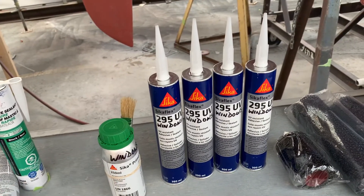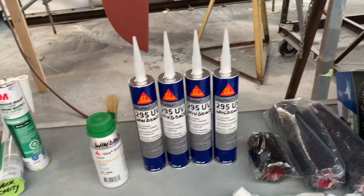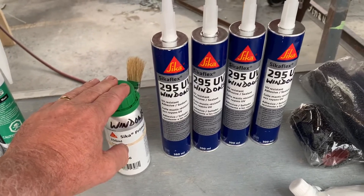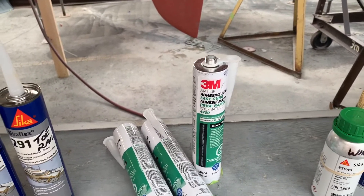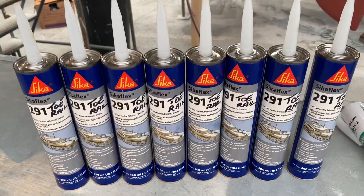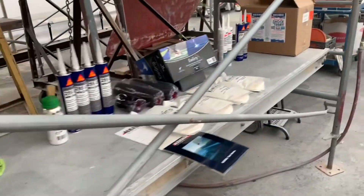We'll do a one-bag test first instead of putting it all in the gallon and mixing everything together. For the windows, we had to switch to a Canadian product because I couldn't get the primer for the U.S. product up here in Canada. So we're going to use Sikaflex 295 UV white for the windows, but first the primer has to be applied to the plastic frame so it gives better adhesion for the caulking. At the store they told me one guy bought new windows, used the 295, didn't use the primer, and they were leaking — and he had to take the whole thing apart. I don't want that. We're going to do the job right. It's only about $43 for this little can, but it's critical.